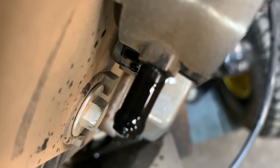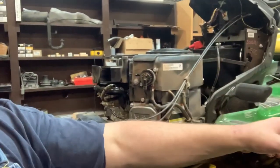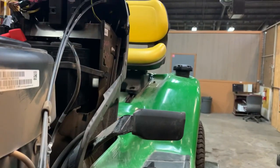The next step — we're going to see if the fuel pump is actually delivering fuel to the carburetor. We know the fuel pump is pumping enough fuel just by looking at the flow. There's a spec on these little Mikuni fuel pumps for how much pressure they're supposed to put out, but in my experience if they'll squirt fuel out with a good amount of force, you're probably good to go. The gas that's exiting the fuel pump smells halfway fresh, so they must have dumped a fresh tank of gas in this thing before I got it on my bench.